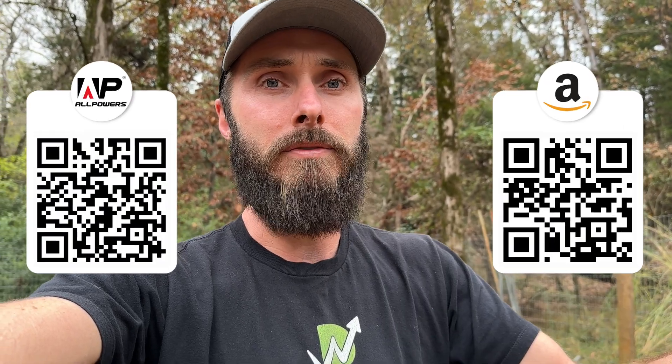So that's it — the tests are done. I went back and checked all the things complained about in the previous YouTuber's video. He was pushing the wrong button, so he didn't get into Wi-Fi, which meant he couldn't change the charging wattage setting. The voltage issue I can't fully explain — mine is at 120 volts, his was at 107 or 108. I ran mine from 100% all the way down to 5%, it didn't overheat, and it had 80% efficiency. It did a really great job. Maybe he just got a lemon.